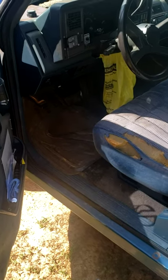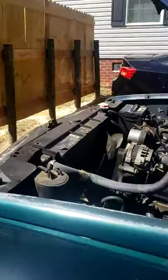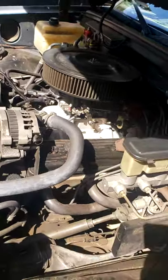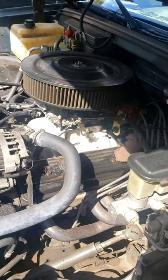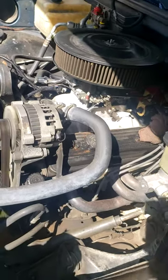The Holley 600 liked the engine to be out around 700 or 750 RPM, and in a way you could hit the cam and in other ways you couldn't. But when I put this 650 double pumper on it, it seems to love to be at a little bit lower RPM. Right now it's at 600 to 650 RPM, but it runs pretty smooth — it doesn't pop and it's got a nice sound to it.